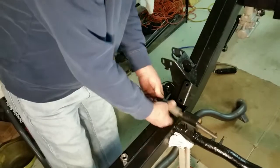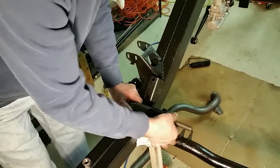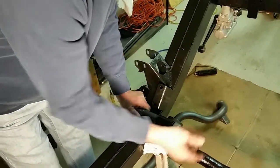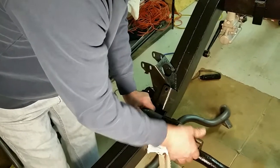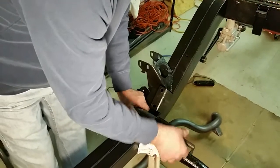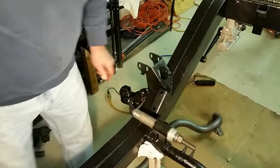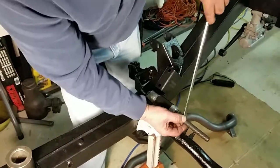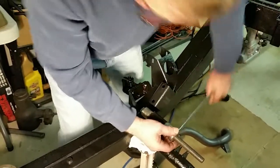We're going to put the bushing on the tool, slide that into there, and then slide our spacer there. Then the bearing, and wind the nut on. We'll pull, just using that piece for now, until we're almost finished and just need to centre the bushing. As the bushing gets deeper into the hole, it's going to come to a stop and still stick out, because the tool now is not going to allow the bushing to centralise.